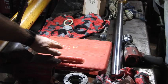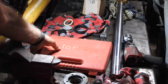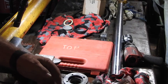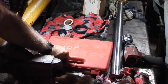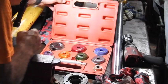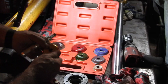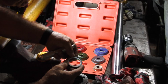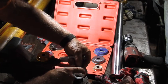I don't know if you guys have a set of seal drivers or not. These are a cheap general set that come from Harbor Freight, but even the cheap set is very, very good. I've used everything you can imagine to drive seals in — usually sockets of various sizes. But these, even though they're cheap, they're very well made and I would recommend them to anybody. I've had these for years and put in dozens of seals on virtually everything with them. This particular one is going to take 59mm — it fits perfectly over the opening. Because this wiper actually goes in opposite of a seal; normally with a seal you'll have a steel spring and a steel ring around the perimeter.